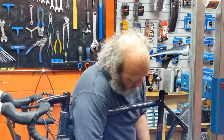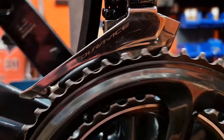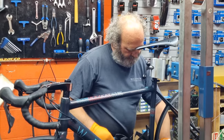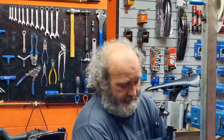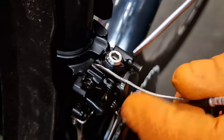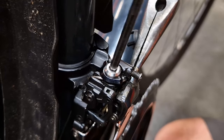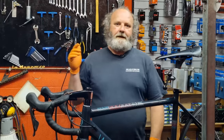Get our bolt back in - I've already put a little bit of grease on the thread. Screw that up and we want it about 2mm above the highest teeth on the chain ring. Just check it's straight - it just needs a little tweak so it's in line with the outer chain ring. Nip that up. We can do finer adjustments when we're actually setting the gears up. Next thing is to get the front gear cable connected - there's a little cutout it has to go through underneath the pinch bolt washer. Get it in there and pull it pretty tight, nip that up - not fully because we might need to adjust it later.